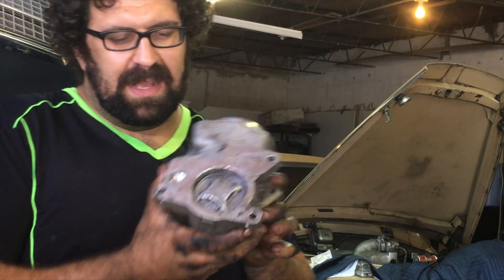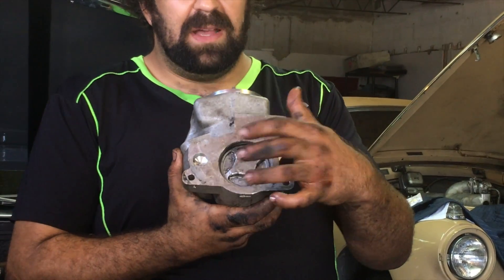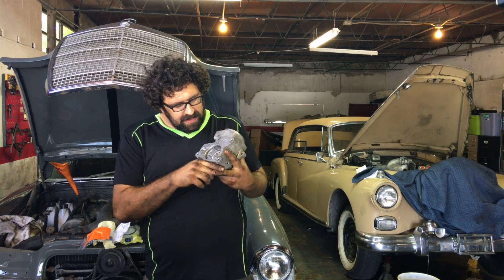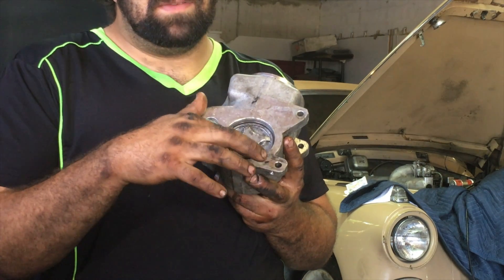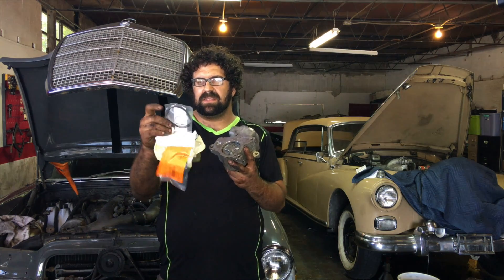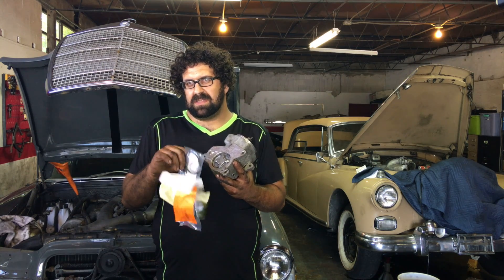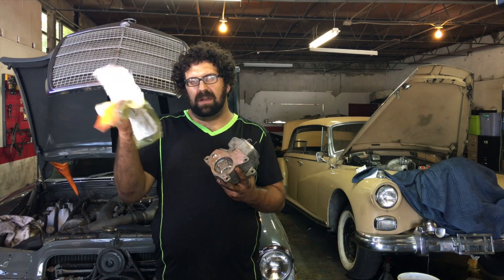The real meat of this though is behind the power steering pump. You have this piston. I use a large clamp to apply pressure to this piston cover and the front shaft — always put the nut on the front shaft so you don't damage the threads. This piston gets pushed in and you can pull the wire retaining ring out. On the back of this cover you'll see these seal rings: one that goes into the body, and one that goes a little deeper into the steering pump pressure chamber. You can pull the front part of the pressure chamber out and then fit the seal in.